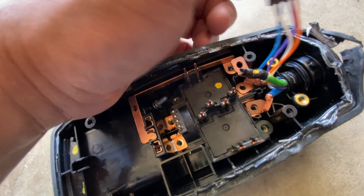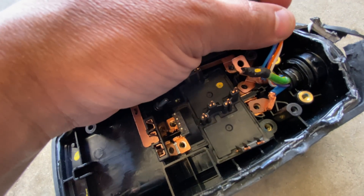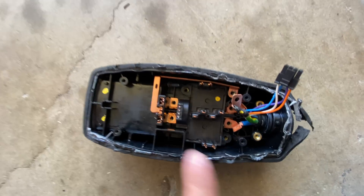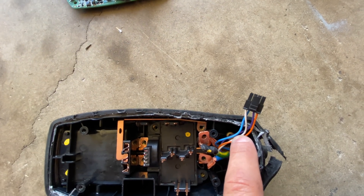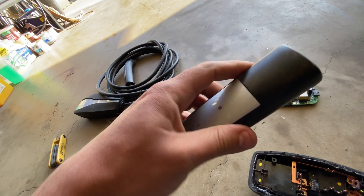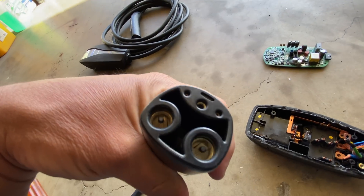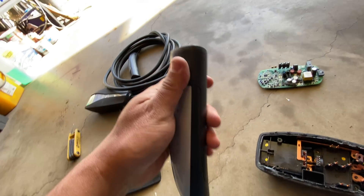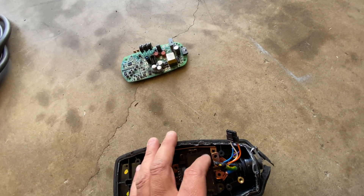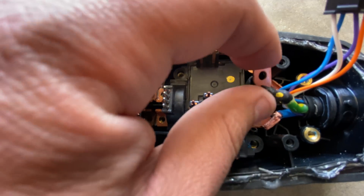There's a proximity sensor in here too, so it knows when you have your hand on the charger and that you're getting ready to disconnect. The part that goes into the car probably also has a temperature sensor to let it know if the connector is getting too hot. Once it detects that, this unit sends a signal via the other two cables to the car to derate or turn the charging process completely off.